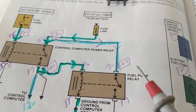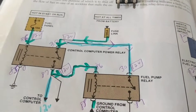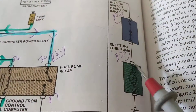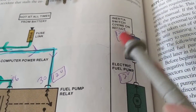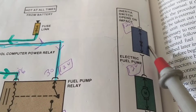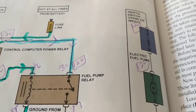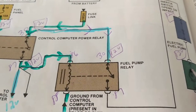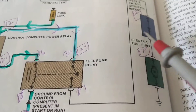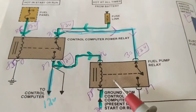Welcome again to another tutorial. We spoke about this diagram before but from the comments there was much confusion — it's a little hard to absorb the details. Basically we're going to a fuel pump; this is the fuel pump symbol. In this case we're going through an inertia switch, which is very common with Ford vehicles. In case of an emergency impact, this opens up the circuit, cutting the fuel pump so no fuel goes to the injectors — it's a safety valve. We have a relay going to the fuel pump.